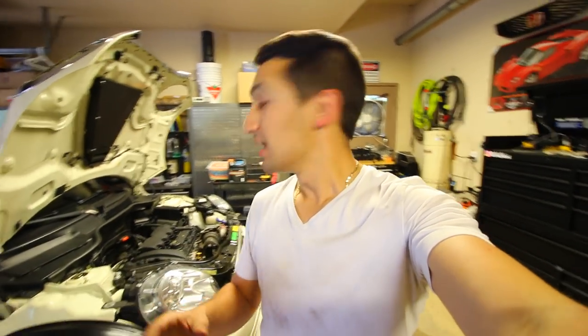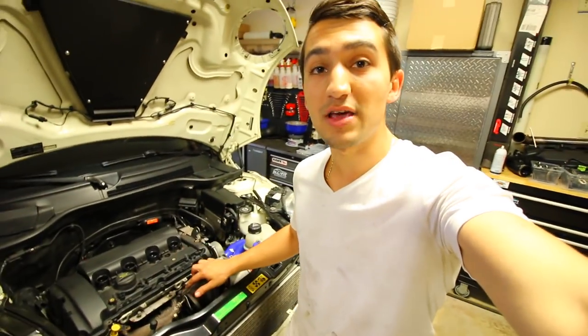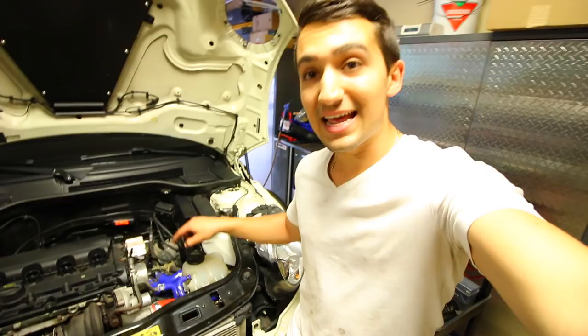I just checked my camera and I have about 120 gigs of footage to go through, so I'm going to leave this as part one. As it stands the motor is pretty much ready to be disassembled, but we still need to drain the coolant and engine oil. After that we can take off the exhaust manifold along with the turbocharger, remove the thermostat, and continue further disassembly. If you have any questions about this video or want to see the products I used, check the description. Thanks for watching — I'll catch you in the next one.